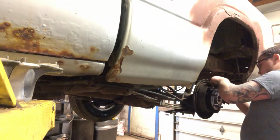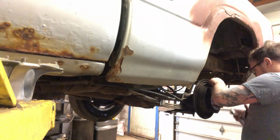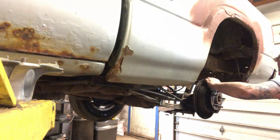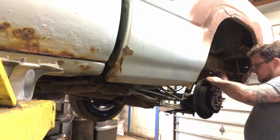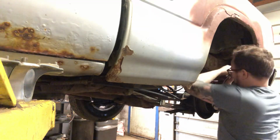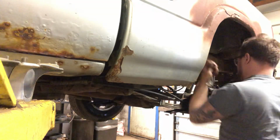These two springs hook together. Depending on what wheel cylinder you're doing, things will be a little different where the springs are. And I've got spring hooked into everything it needs to hook into, except for the top. I'm going to see if I can get that to go into its place with these vice grips real nice and tight on there. There we go.